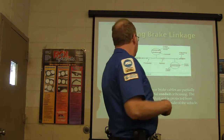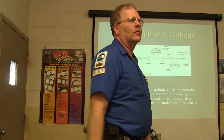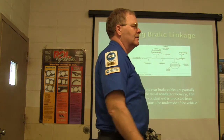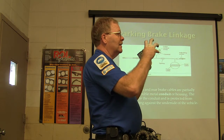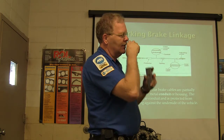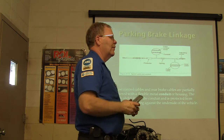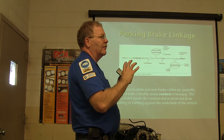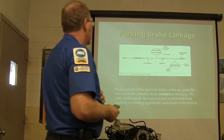All right, so, okay, that one right there, we've got to fix the 4-wheel drive on it. Who wants to fix the 4-wheel drive? What's wrong? I know some of you guys really love 4-wheel drive. That stub axle that goes up in the front end had actually come out of there and sheared off. This is the one the ball joint popped off on and it caused issues. And so we've got to put a CV axle in it. We also have to take the cover off the front end and see if any parts in there need to be replaced, but anyway, she's over here to do that.